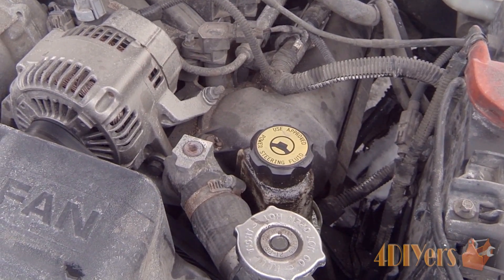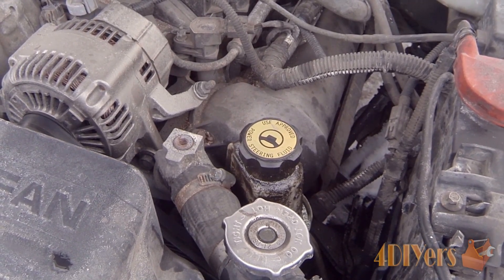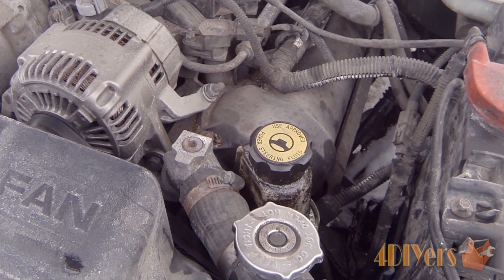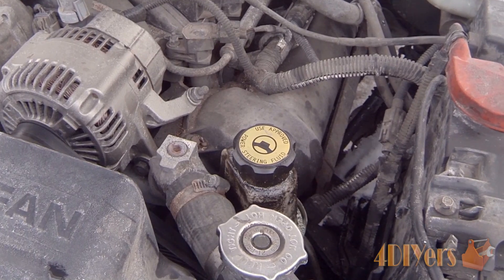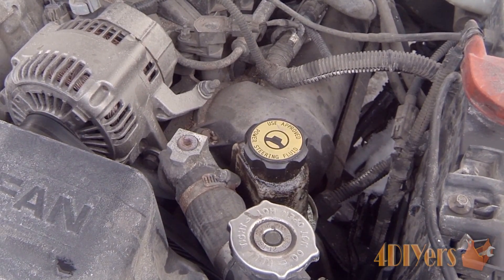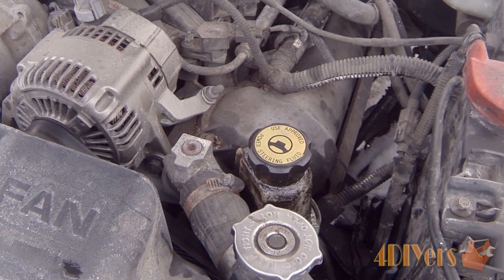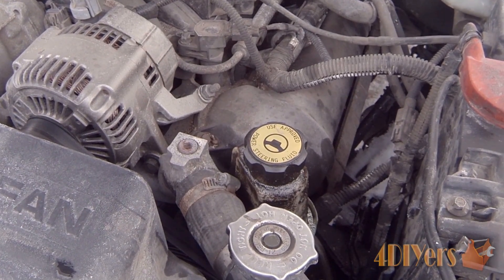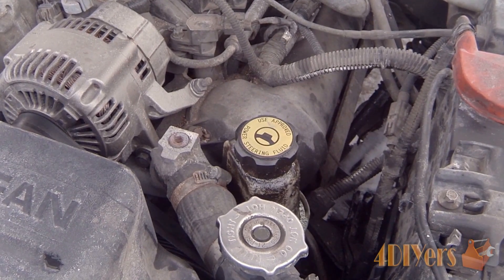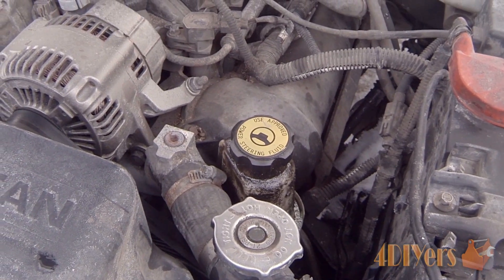If your pump isn't pumping a sufficient amount of fluid, the fluid may be dirty. Another issue is that some systems are equipped with a filter that can get plugged up, starving the pump of fluid, or your fluid may simply be low. This can cause hard steering or the pump will start cavitating or making a whining sound. Another issue is a faulty dump valve. The dump valve allows the system to build up pressure, and it can fail over time — the most common problem is that it gets stuck open, therefore not allowing the system to build up pressure.